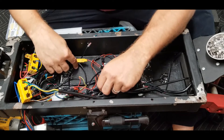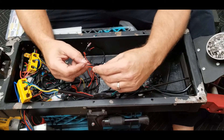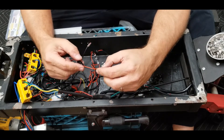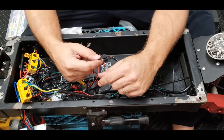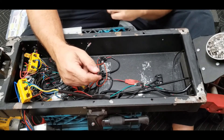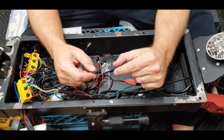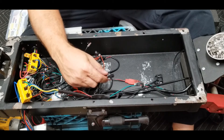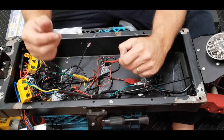So you'd have your 60 volt incoming voltage, and I added 12 volt lights to the back because I want my red LED lights to be a little bit brighter. That's a fairly simple upgrade. In my particular scooter they also have an extra connector — I think it's possibly for an alarm, or maybe it's just an extra connector for lights. I can get another connector added there, and if my lights were 24 volts I could add one of those DC to DC converters and solder on my wires for 24 volts — boom, extra lighting on the scooter.